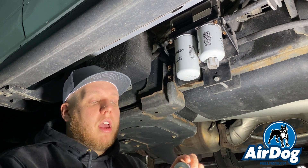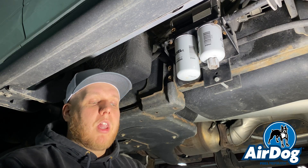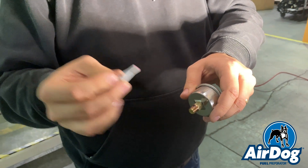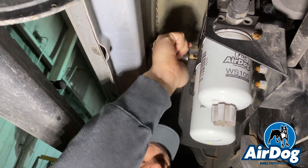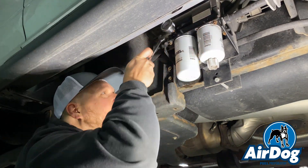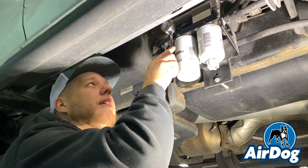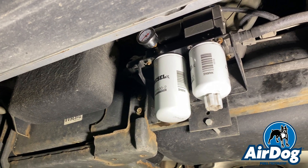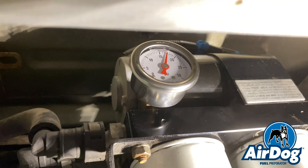One thing is, even though this is an MPT-style thread, you never want to use Teflon tape because it is not diesel safe. Loctite has an actual thread sealant — it appears that it's 545 — and we've found that it works very well. So we went ahead and got that sealant put on the threads, start it by hand, take a wrench, and get that snugged up. Again, this is an MPT thread so it is a tapered thread — it needs to be relatively tight, but no need to kill it. We're just going to go a little bit further here to get the gauge lined up properly. And that installation is done — it's just that easy with the pre-installed port.